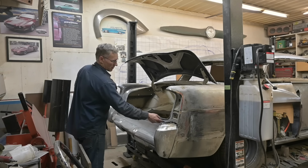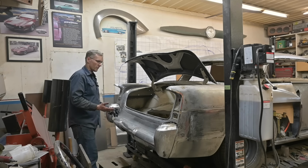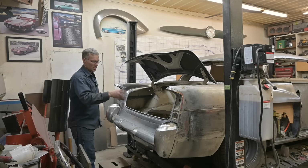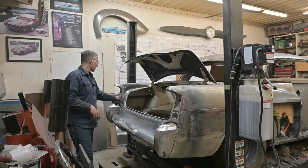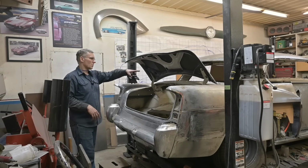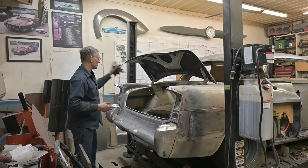We also got to get rid of this Bondo that's in here, grind it out, and it looks like actually fiberglass. It's kind of funny. It didn't grind like Bondo when I was in there earlier. Got to find out if there are any holes and get that taken care of. Get the lead taken care of, remove it, weld that up. There's some seams up at the top, got to weld those up. Because when the car did come in, I noticed there was a crack through here.